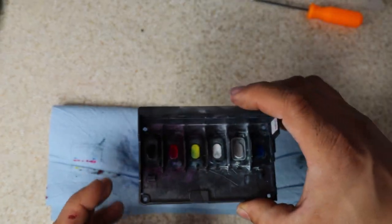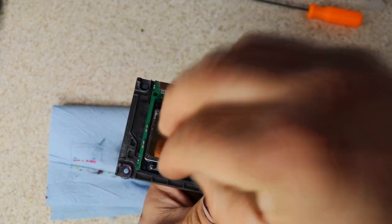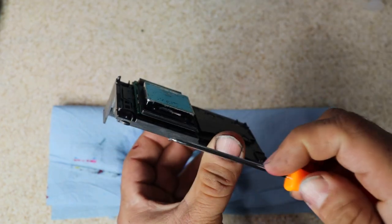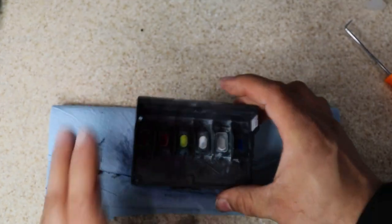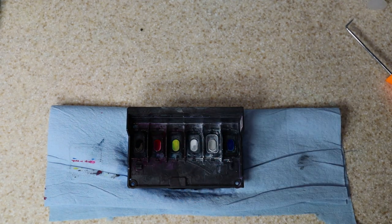That tells me I just pushed solution through the bottom of that printhead. I don't want to keep this upside down for too long, but pretty much I'm pushing solution through here. You see I'm getting this wet, but not this area — all the surrounding area I want to keep dry. Never, ever get any water in there. So now I'm going to try to clean this a little bit more and then we're going to keep moving forward.